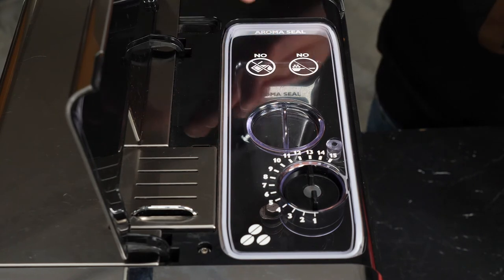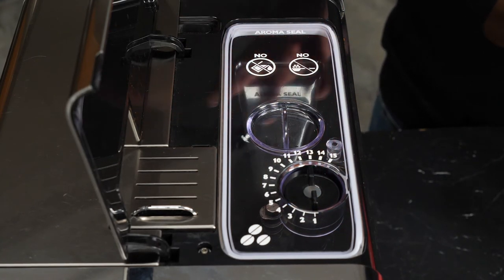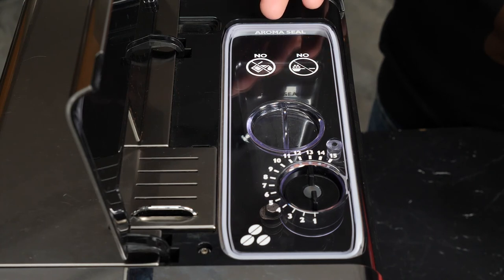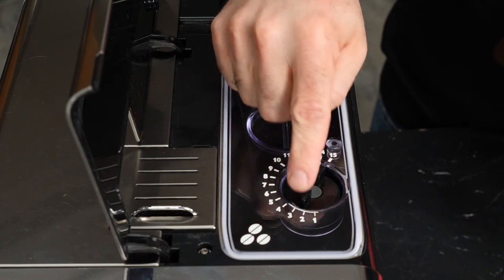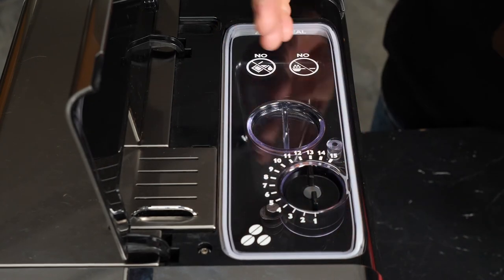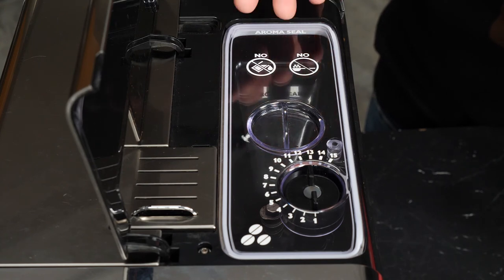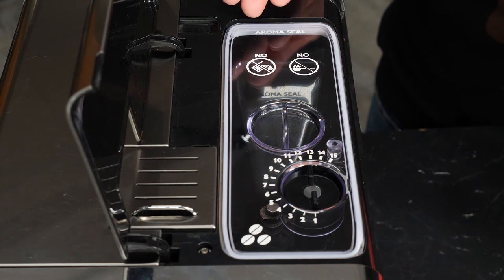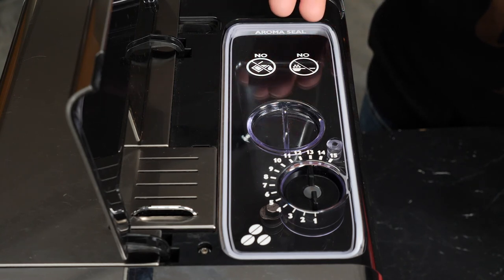The Babila has 15 settings for its grinder. In my opinion you're probably good with the first couple, but I always prefer to set my grinder to the finest setting — I find that helps get the most rich extractions, though that's up to you. One important thing: when you're first setting your grind, make sure you do that while the hopper is empty. Before adding any beans, go ahead and adjust by pushing and twisting — this arrow lines up with your current selection. You want no coffee between the burrs when making adjustments, as beans between the burrs when going finer can damage the grinder. Gaggia recommends making only a single adjustment at a time, brewing a shot, and then making another one.